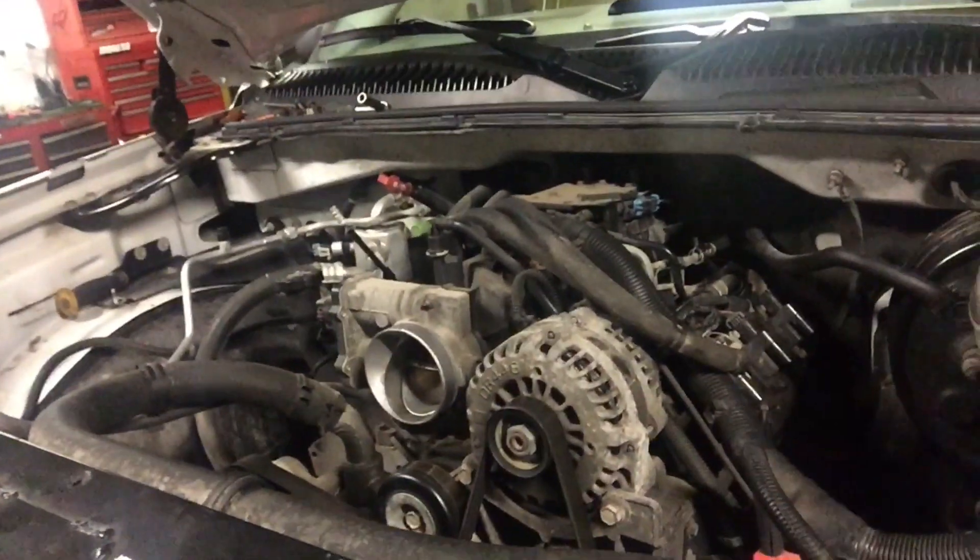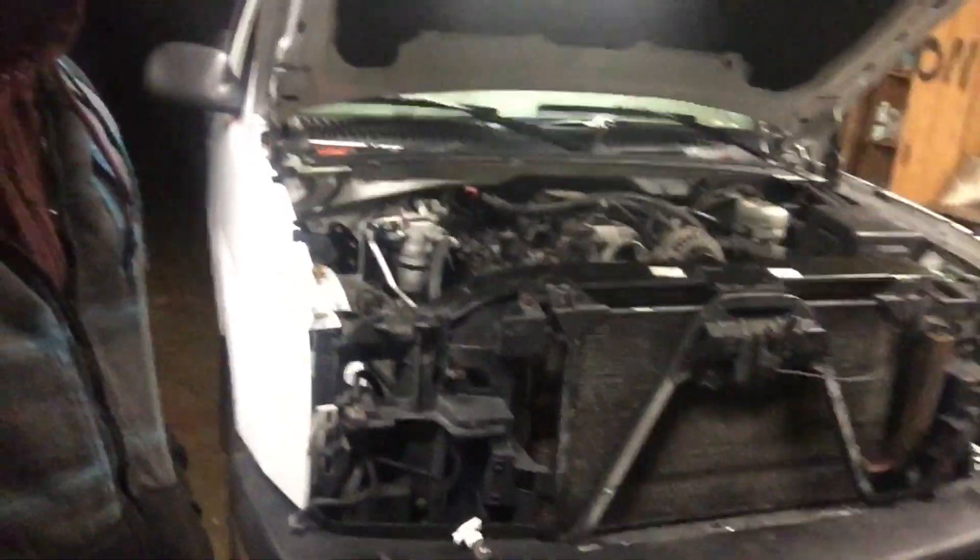In the meantime I'm tearing apart a few things — got the exhaust off, intake off, drained the coolant, and the whole front end is off: the grill, headlights, all that, to fit the intercooler. Just prepping it so it's not as much work all in one night. Tomorrow we'll have the turbo kit here and hopefully have everything hooked up.